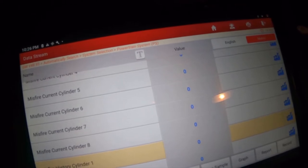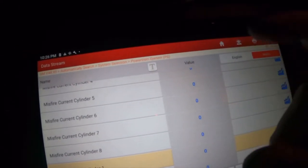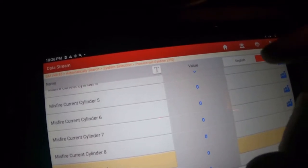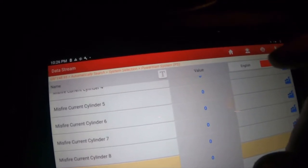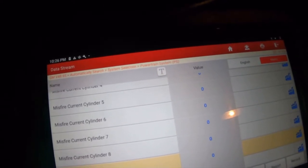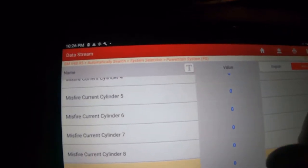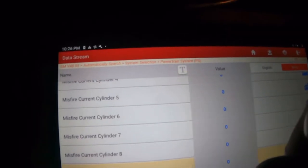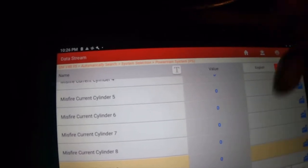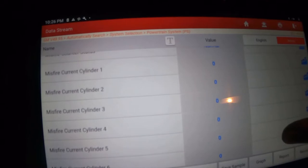I took the two rocker arms off, and I was able to hear the lifters expand, so I kind of took a gamble on that. I didn't know, but I assumed the lifters weren't collapsed. The push rods were straight, so that wasn't an issue.